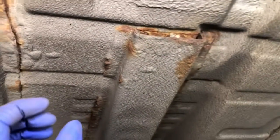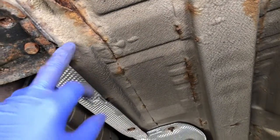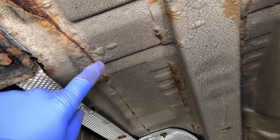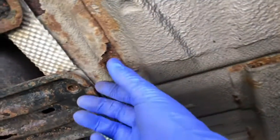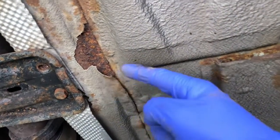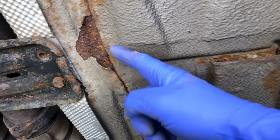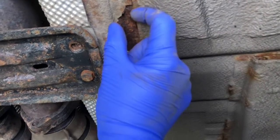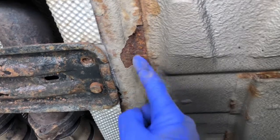Trapped corrosion is where you've got panel overlaps. Here's another example where this is the floor pan and this is the transmission tunnel supporting bracket. You can see the bubbling nature of where the corrosion is growing underneath and causing the seam sealer to delaminate off the floor pan. But as well as taking the surface corrosion off, what are you going to do with the corrosion which is underneath that panel and on top of that panel? If you could imagine seeing through that panel, underneath it is going to be just as violently corroded.